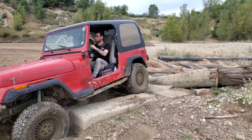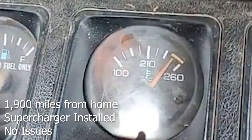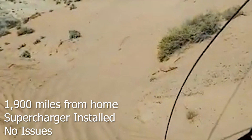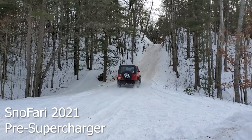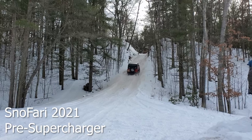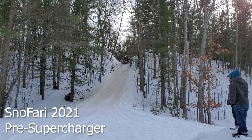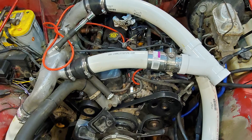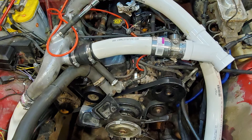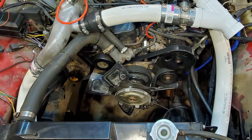The cons: we're going to talk about how bending PVC takes heat, so if it gets soft and malleable with heat it could do so again in your engine bay, which is generally known for being hot. The other concern is cold weather — I haven't driven the Jeep all winter since the modification was done in summer, but it's possible PVC could become brittle in cold weather, and we can address that in future videos if it arises.